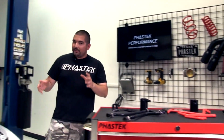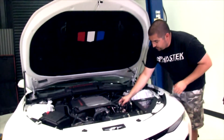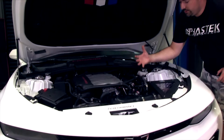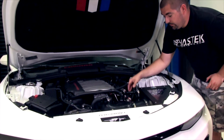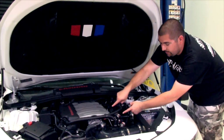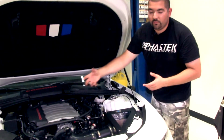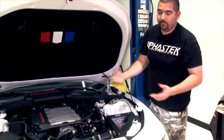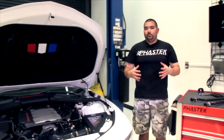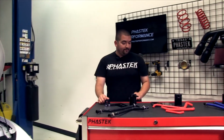But over here, it's kind of hard to see on this car just because we have the nitrous in on the car. But where it goes on this car is right under these vacuum ports, right under the intake. And that's typically where you'll see a lot of catch cans make their connections for the motor, because that's right at that intake port, right at those intake lines, is really where a lot of the vacuum and everything goes through. So that's the spot you really want to pay attention to when doing these catch cans. So a lot of manufacturers, they'll do it that way.